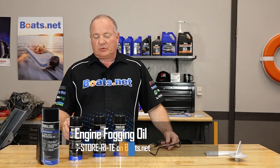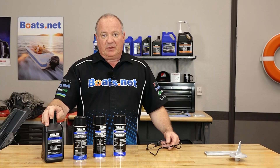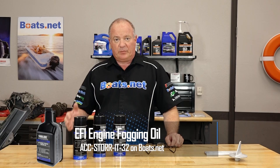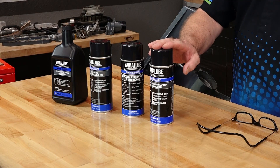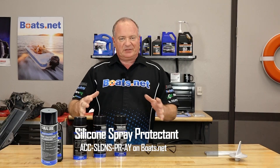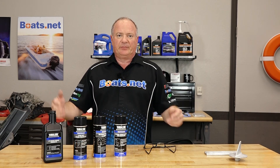Now if you're setting it up for long term storage, that's when you spray on the inside. If you're dealing with a fuel injection system, they've got that covered as well. Each time you take your boat out and bring it back home, you want to flush out that engine thoroughly. At that point, spray it down with cleaner and then finish it off by spraying it down with the silicone, which basically encapsulates all the different exposed parts of the engine and keeps them from rusting.